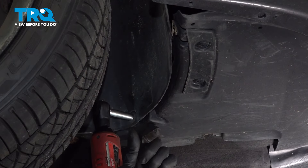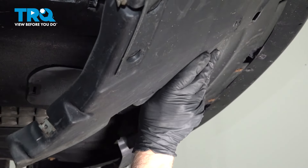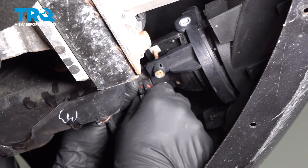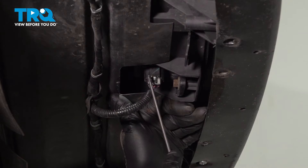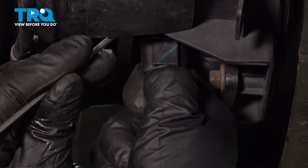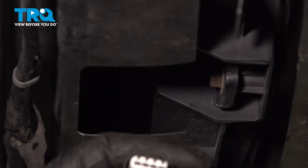And right here, and the same on the other side. Slide this down and it slides right out. You can disconnect the connector — there's two little tabs on the side. Slide that off. Disconnect the connector right here in the center. I'm just going to use a pick. Slide this little lock down — should just be able to push down there and slide this off. This one's a little tricky; I'm just going to use the pick and get above it, just push that tab down.